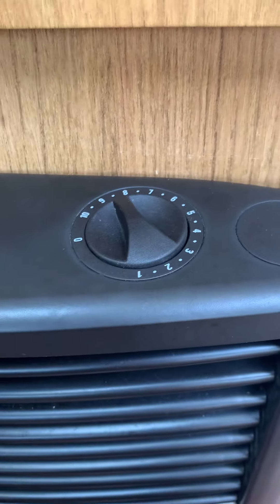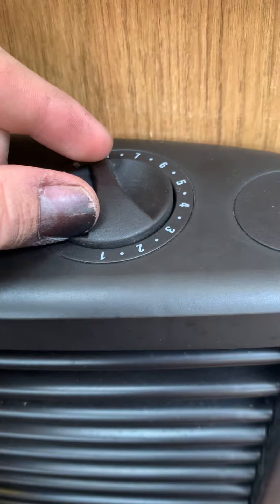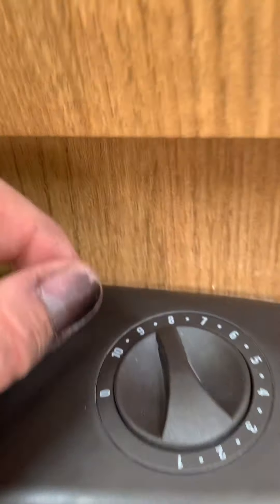We can't see it on the video anyway. I've got it around to about two then push down — now you can see it down there, that nice little blue flame. Hold it down for a few seconds, and then turn it around to about four or five and let go of it. So that's what I'm going to do. Now it's a bit too hot at the moment. So that's a good example — because I had the heating on before I came in the van, when I let go at four or five, it wouldn't stay on. The reason is it's actually too hot inside there already. So all I did was turn it all the way around to about eight or nine and then it did stay on.